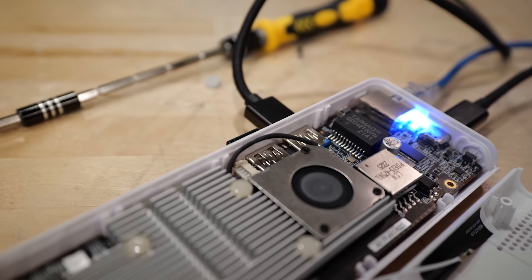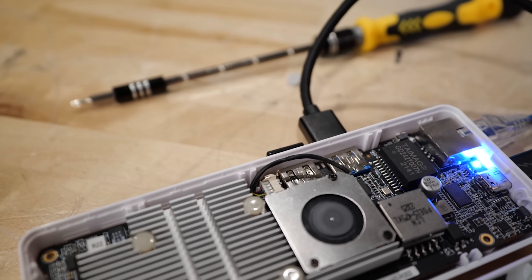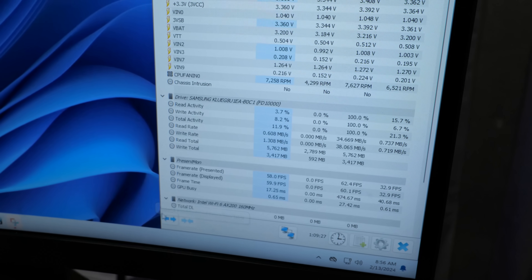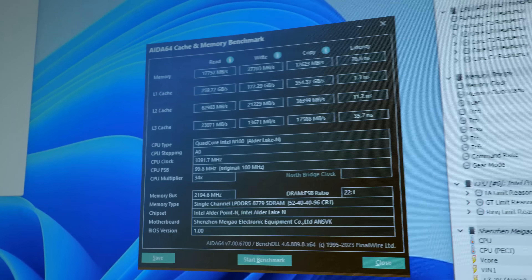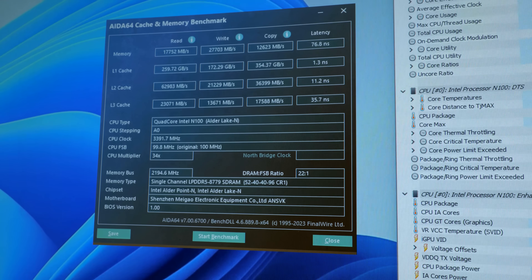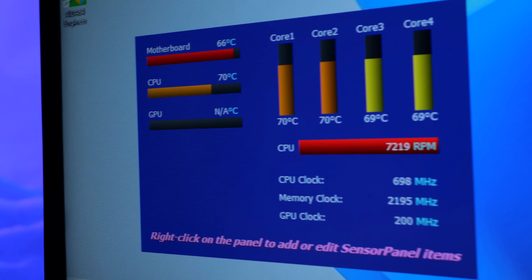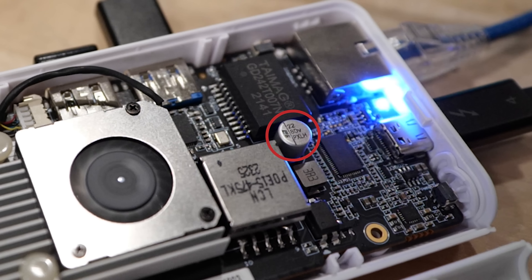Even with the passive heatsink in the bottom, under full load with power over ethernet only, this is not an ideal situation in terms of heat production. Performance is much more satisfactory when it's not running from power over ethernet, at least when it's been under load for a long time. With external power, our Aida64 results are about where we'd expect — single channel DDR5 at a strange speed of 4788, 81 nanoseconds of latency. Geekbench scores are looking a lot better with external power. I reached out to MinisForum, and they confirmed it's a known issue — reduced performance when running power over ethernet. That electrolytic capacitor running so hot can't be great for its lifetime.